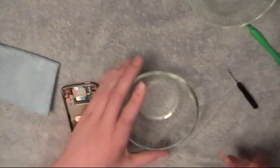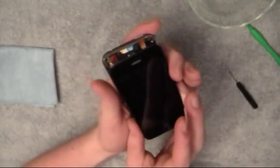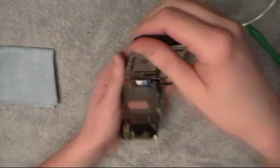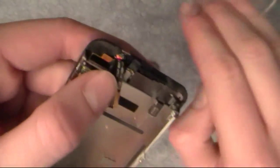Set aside the bowl, orient the phone how it goes on, and flip it up so the headpiece is up. Then put the three cables back in, starting with the small cable labeled cable number three — you can see it has an orange three on it. Slide that in and then pop the black clip down.